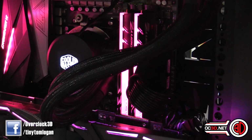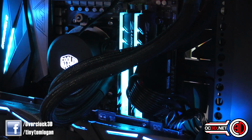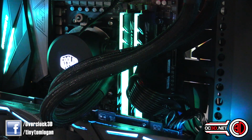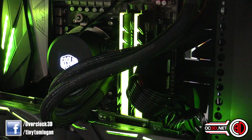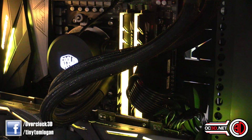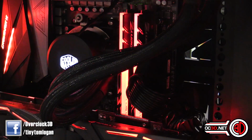You can check in CPU-Z. Whatever CPU-Z says, you've got a little thing at the top for your memory. Click that, and it might say, for argument's sake, 1333 megahertz, but you need to double that. So then that would mean 2666. So as I'm running 3200 megahertz, mine says 1600. But anyway, so G.Skill RGB, absolutely, without a doubt, the best RGB implementation on memory at the time of filming. I absolutely love this stuff.